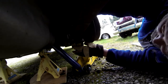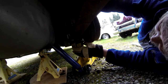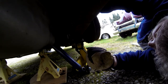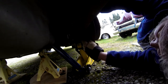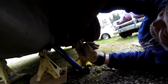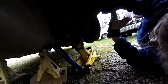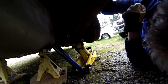If I could equalize that — get it off the jack stands which are basically pushing up on the axle — and equalize it a bit, so that one of these bolts that I've already loosened, or another one, I can get off of there rather than cutting the U-bolt. I will do that if this doesn't work. I kind of understand the physics of it, but you do one thing and it pushes the problem somewhere else, so we'll see.